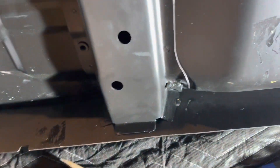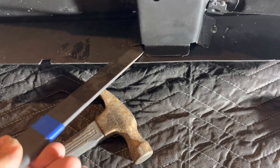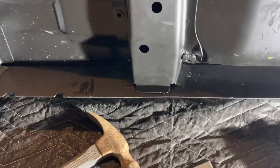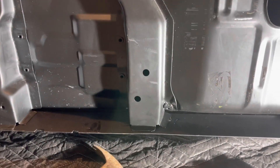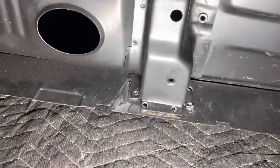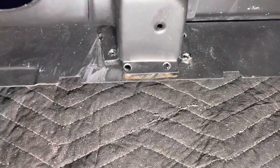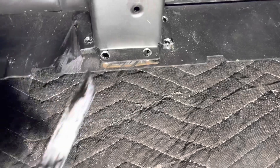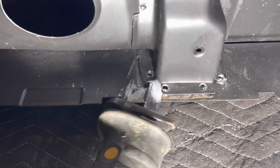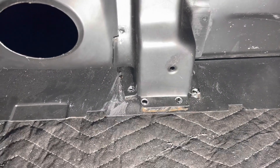You go real slow. Once I get through, you kind of feel it get through the metal. I'll take this thing and just stick it under there and bang on it and pop it. It might bend the metal a little bit, but that's what hammers are for and dollies and all that stuff. One of the tricks I learned: there were five spot welds and then regular weld at the back. So I used the spot weld cutter, cut those five, and popped the panel out, which allowed me to get a sawzall blade in there. I worked from the inside out to get that weld at the back with the sawzall blade and cut it out enough to pop it out with that seam cutter. Hopefully it works for everybody else.